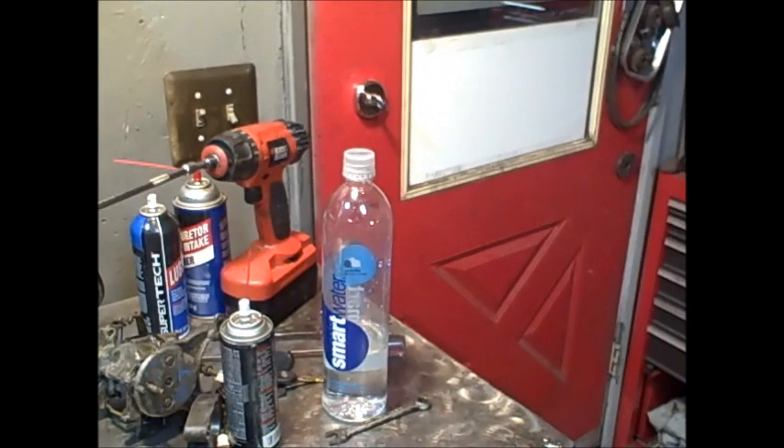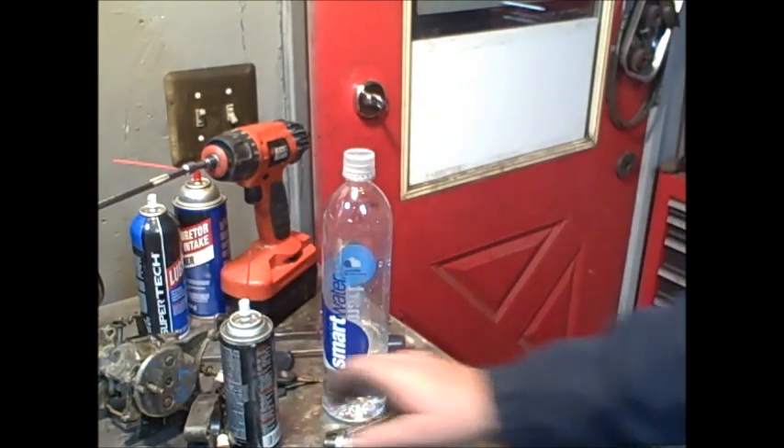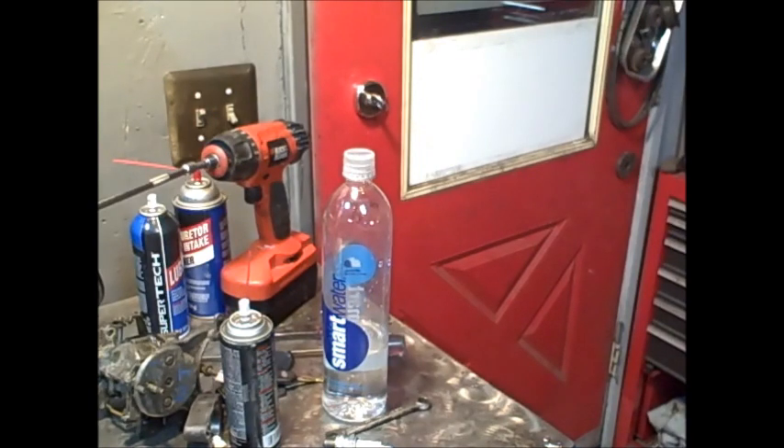Could be salt has eaten through something. I can show you also real quick — you can see the top spark plug hole is pretty black and everything, and if you look at that bottom spark plug hole, there's not much black in there, mostly watery looking, muddy looking. So water is getting in somewhere. I'm going to pull the head gasket first and see what the cylinder looks like.